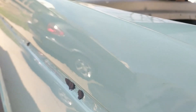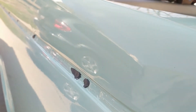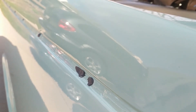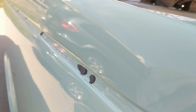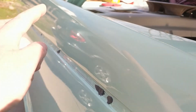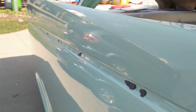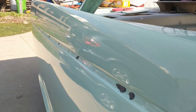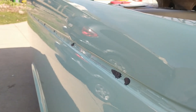Painting in your driveway you're obviously not going to get a perfect result — you're going to get some orange peel. But there's plenty of paint on here, I probably got seven coats, so it's really nice and thick. This is single stage and it'll buff out. Then it gets covered in wrap anyway, so it's kind of funny that I'll be doing all this and then just wrapping it — same with the roof. That's cutting and buffing for now.